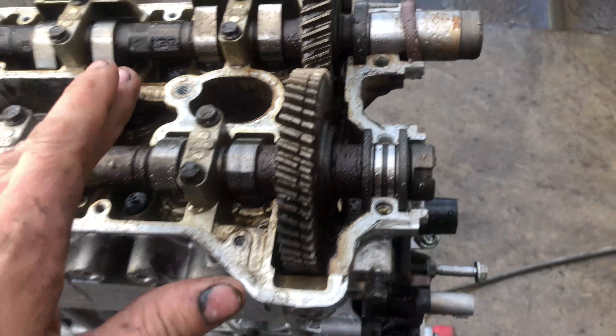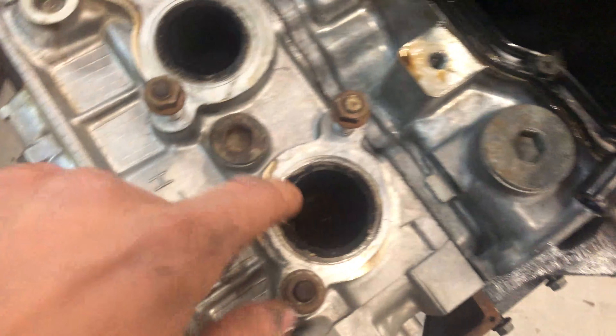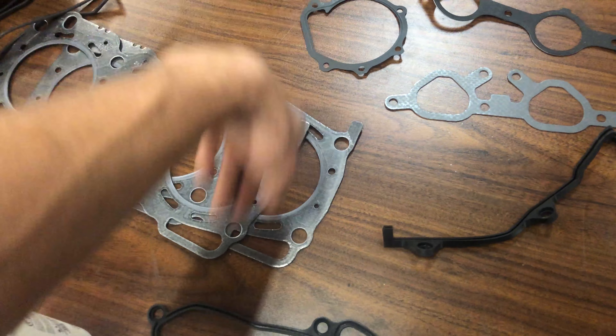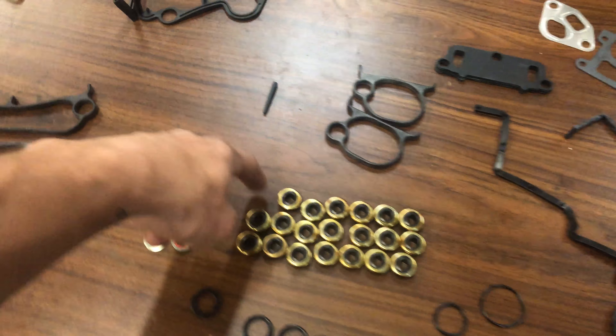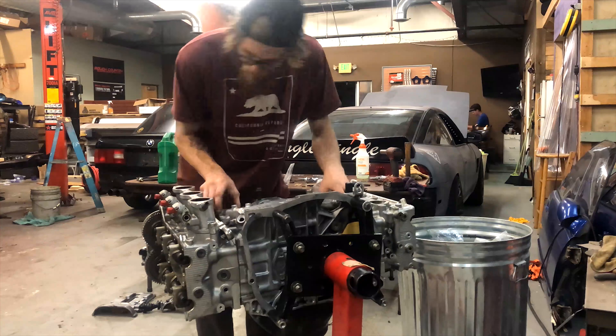Here's the motor freshly power washed. It's still really dirty in some spots — I'm going to use some aluminum cleaner and a brush to get most of that off. The reason some openings are open and others are taped shut is because I don't want water in the cylinders. A little bit of water in the oil pan area isn't a big deal since that'll all be cleaned out. But I don't want water in the oil system near the high-pressure oil pump because that'll send it into the bearings.